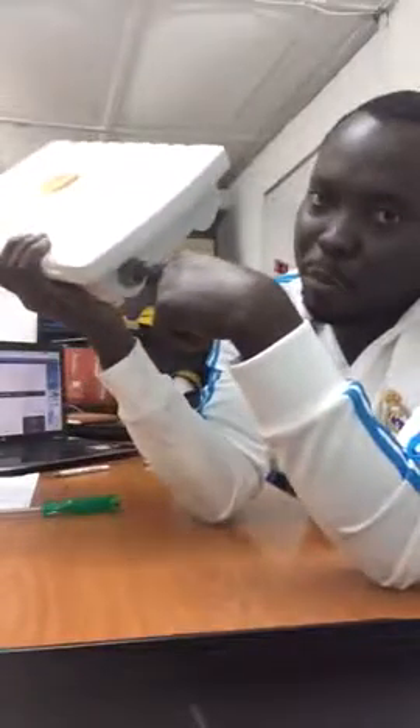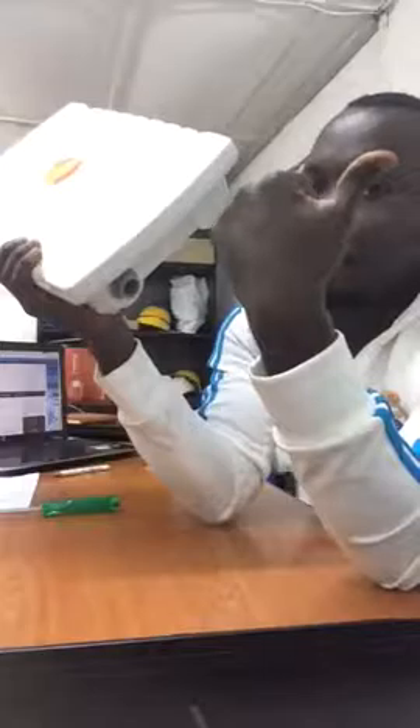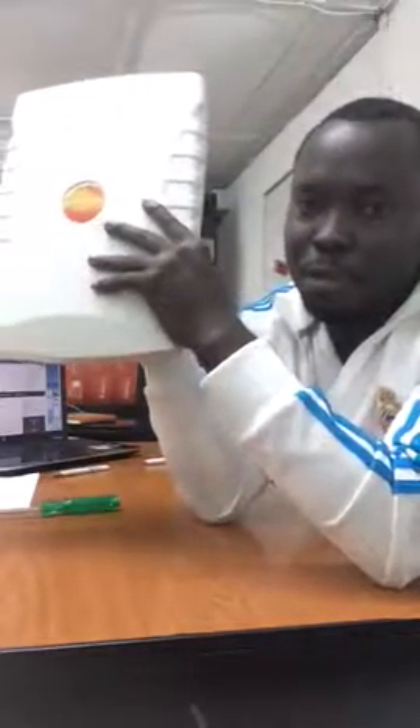To configure this radio, you need a POE adapter. You run the cable from the POE adapter to this place while the adapter is plugged to power. The other cable — the one that goes to your laptop — will be plugged to that point on the adapter. Once you have that done, you can log into it using WinBox and then have your radio configured. Thank you guys for watching, and keep looking out for more videos on timikit.com.